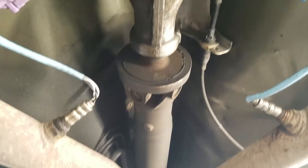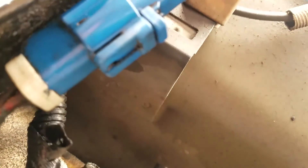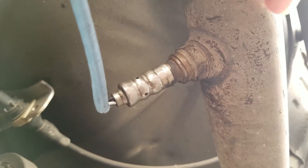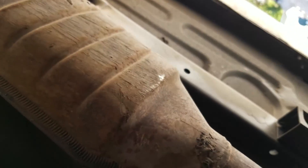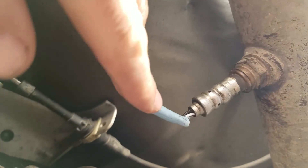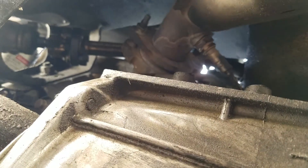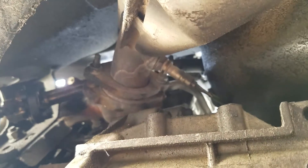They are right here — I've cleaned them up. They're blue and purple. So the same rule applies with these — you've got a little flat head in this gap here and push down this little tab with your finger and it comes right up. There's your 22mm. It just takes readings from your exhaust. The rear ones don't affect drivability; the front ones do. So if your front ones throw an error code, you better sort those out because they cause lean and rich conditions — more air to fuel ratio or the opposite.